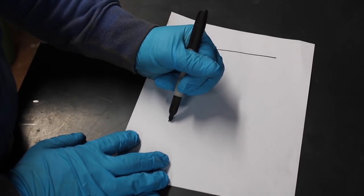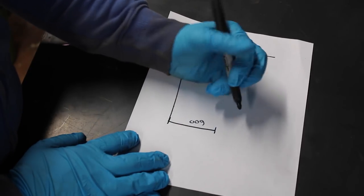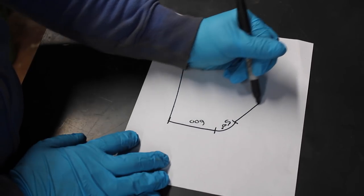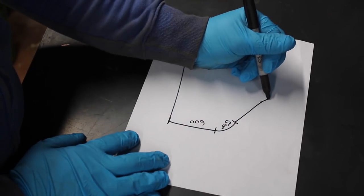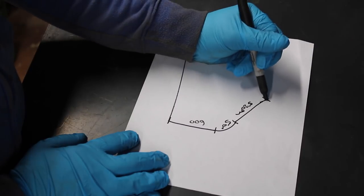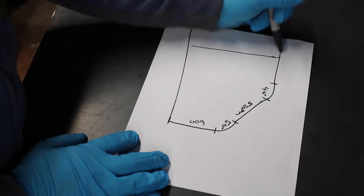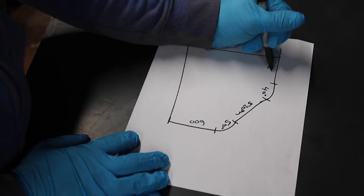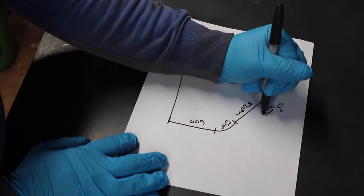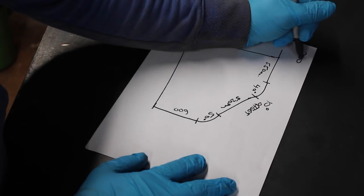Time for another crude sketch. From the floor at the A-post to the start of the first bend is 600mm. We'll make a 50 degree bend rearwards with a 520mm length, before a 40 degree bend and a 550mm length to the main hoop. The 40 degree bend needs to be offset by 10 degrees towards the outside of the car to mimic the windscreen pillar. I'll use a 2 metre length of 1.75 inch 12 gauge ROPT 510.